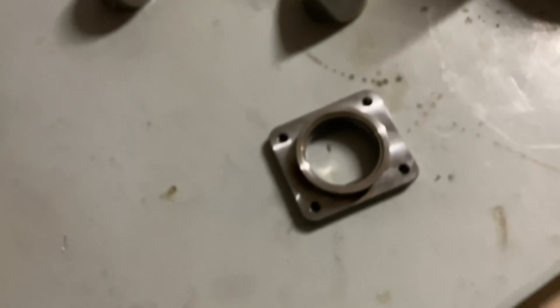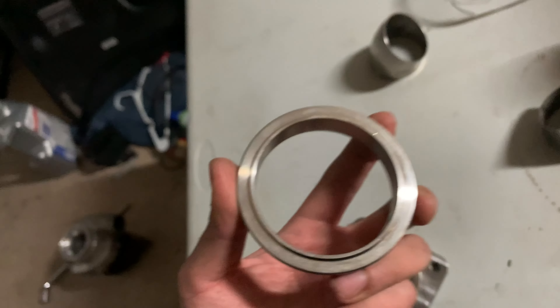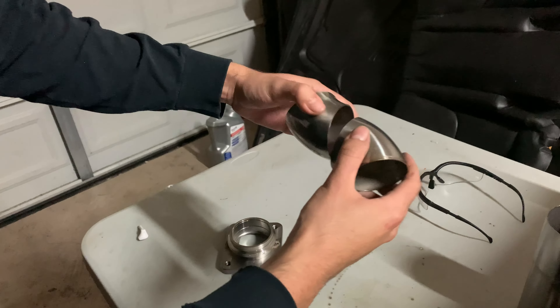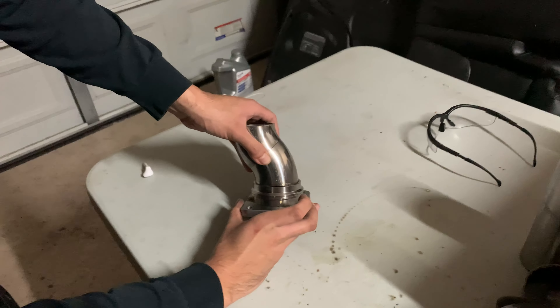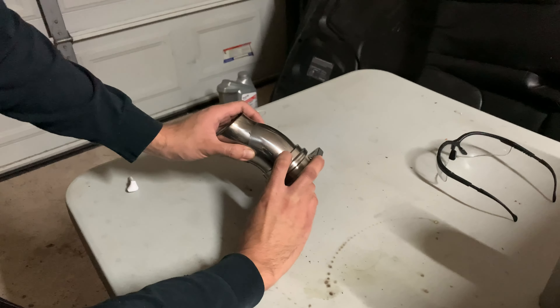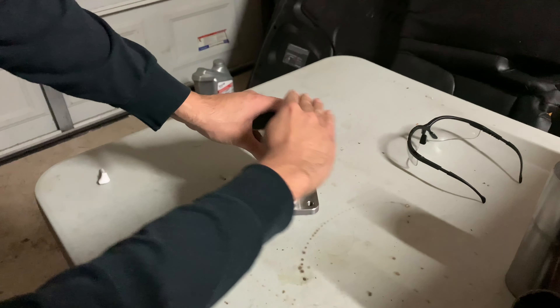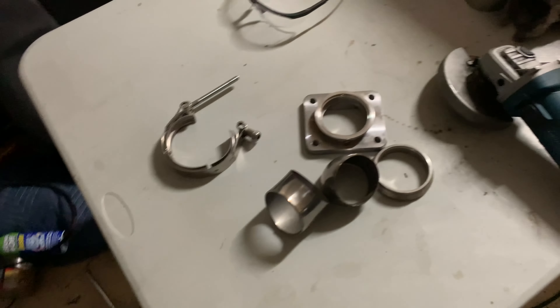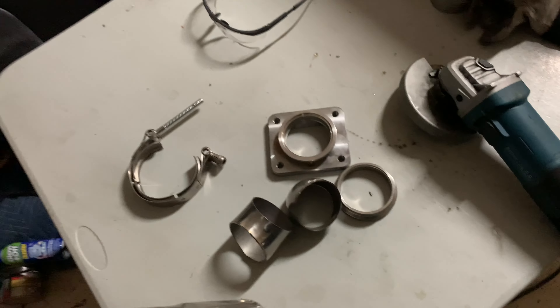I tacked the V-band straight onto the T4 — I don't want to deal with all four bolts every time I remove the turbo. I couldn't find a T4-to-V-band adapter for a decent price with shipping, so I grabbed a 2.5-inch V-band and did it this way. I took a 90, cut it right in half, flipped it, and tacked it on here. This accommodates the bump of the transmission — we do a slight dip down before getting to the other side of the crossover pipe, so I started working kind of backwards on the pipe.